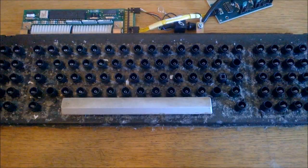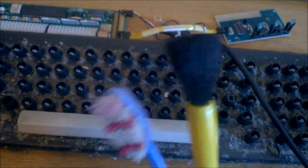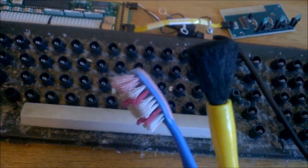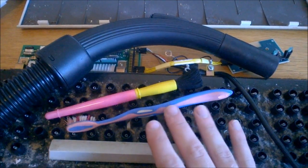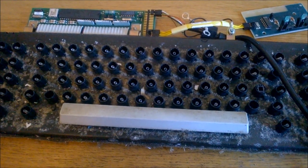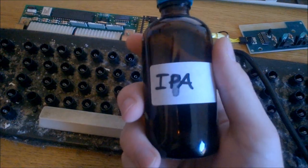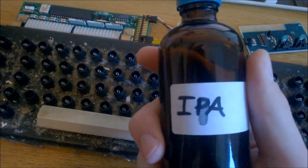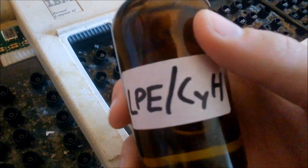While the caps are off, you can clean the chassis and case — this one looks like a textbook example of 'oh dear' to me. For the chassis, use a toothbrush or a longer-head brush and just scrub, preferably while also hoovering at the same time. That combination should get the vast majority of dirt out. Don't use water near the electronics. If you find greasy or sticky stuff, use IPA — isopropyl alcohol — which is electronics-safe.